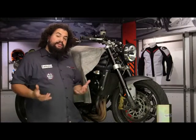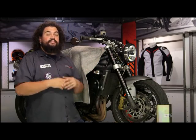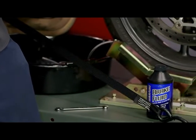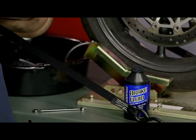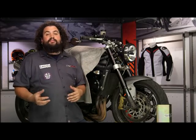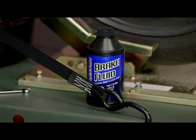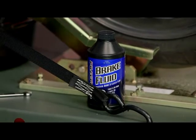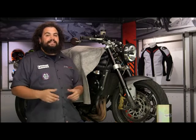One of the other things to keep in mind is that brake fluid is hygroscopic, meaning it pulls water from the air. Water has a boiling point that's much lower than that of brake fluid, and brakes are subject to extremely high temperatures. So since it's pulling moisture out of the air, you want to use brake fluid from a sealed container. I'll buy lots of little containers so I always have fresh small containers to open in the shop. It really doesn't make sense to buy a giant gallon jug of brake fluid — buying small can help you out.